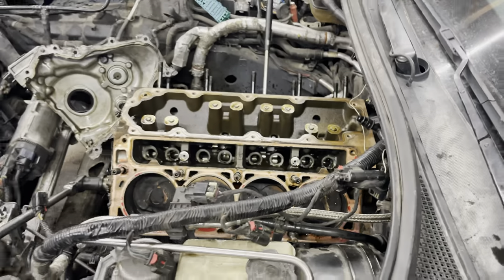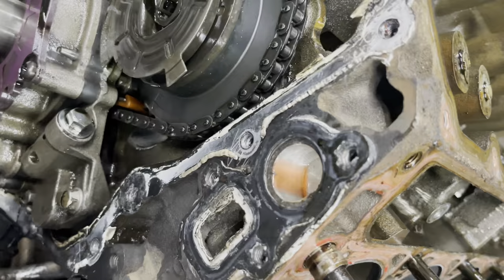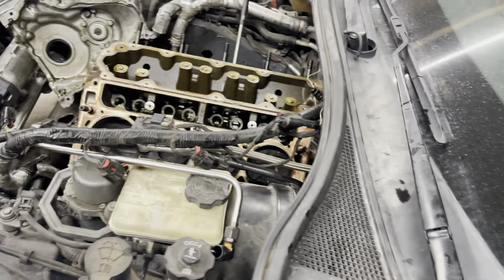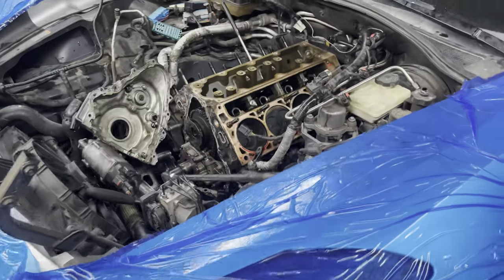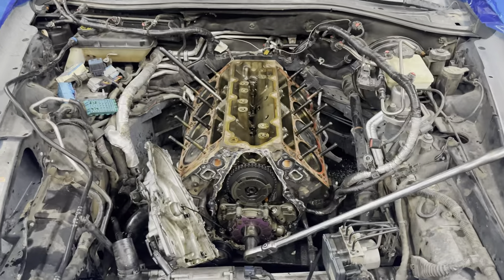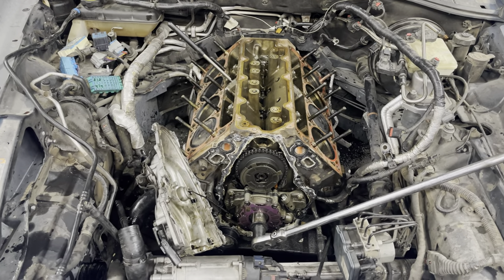We'll clean everything up, get all this extra silicone off. I don't know who puts silicone on water pump gaskets, but please don't do that — and please don't weld exhaust together. Headers come with flanges for a reason; they're supposed to be removable, not have to be cut off and re-welded. We'll call it there for this video and continue in part two for the put-together. You guys can hear it before and after — the lifter tick versus it running real good. I just want to ensure we can get that lifter out and that the bore is not damaged, because if it's damaged, this motor has to come out.